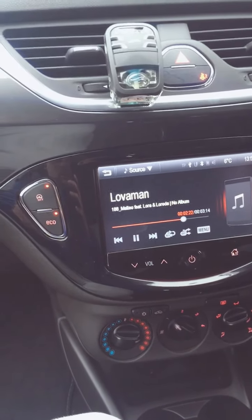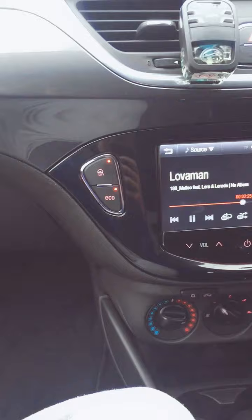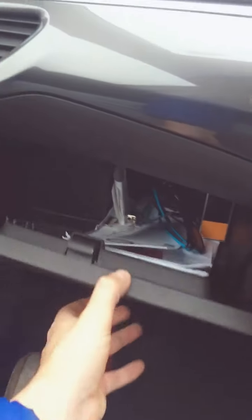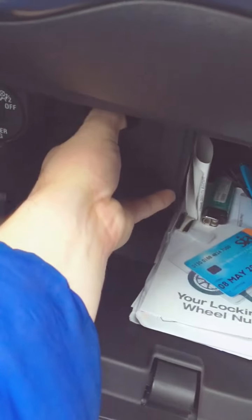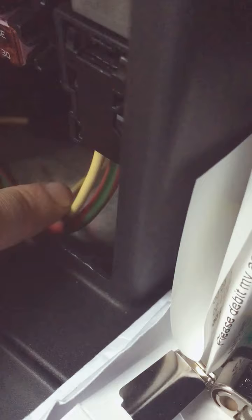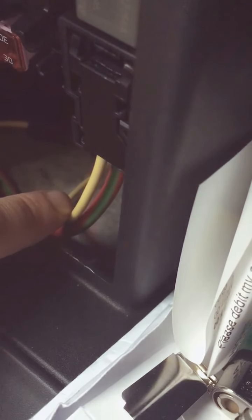For the power, I didn't take it straight from the battery — I took it from the fuse box, which is basically inside here. If you take this out, you can see there is a red and green which comes straight from the battery. The yellow one goes into my actual amp, and the blue one is the remote, which I connected to a cigarette lighter or an unused fuse — which works perfectly.